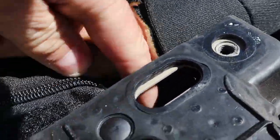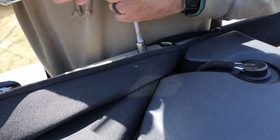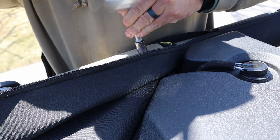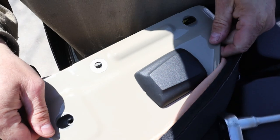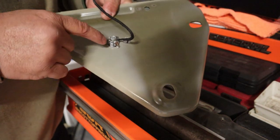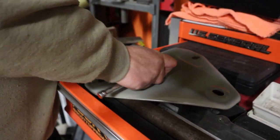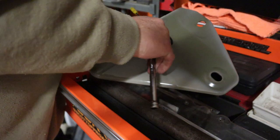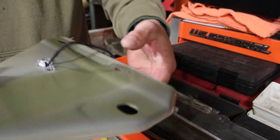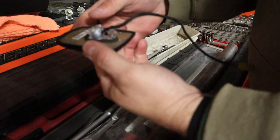Now we're on the passenger side of the Jeep at the top, moving the padding, unzipping it. We're going to get to the plate right above the passenger's head, and that black box — that's your antenna. I believe that's a 13mm socket — undo a few bolts, take that plate off. I did have to lower, unbolt, and lower the speaker pod just to get the yellow plug for the antenna wire between the roll bar and the B-post. Unbolt it from the bottom of your plate, put your plate back on the Jeep, put your padding all back on. These are just push pins or push clips — push them together, pop the antenna out. There you go, that's your antenna.